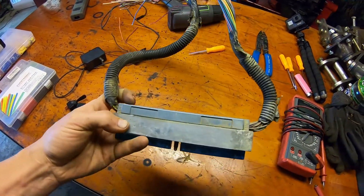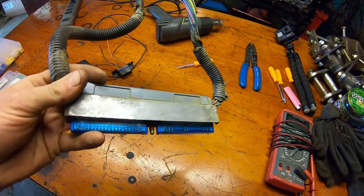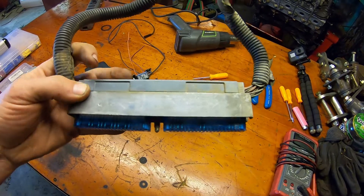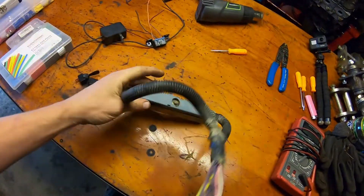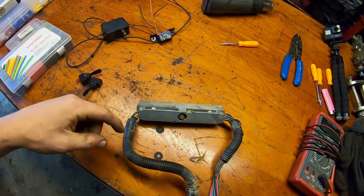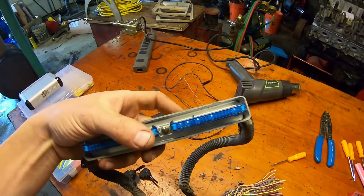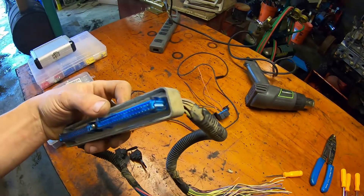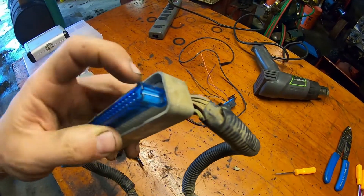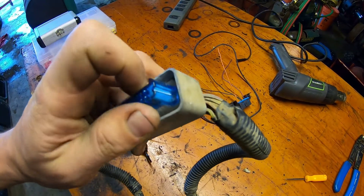Your PCM connector — you don't need to depin all the wires you're not going to use. I'm going to do it just to clean it up, but you really only need four wires out of this. Get the little plastic cover off the back first — it just pries loose. Then there are four wires that you need to keep. If you decide that you're going to depin your connector, take all the extra wires you don't need out. You need to get these little blue covers off first.